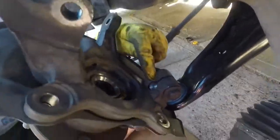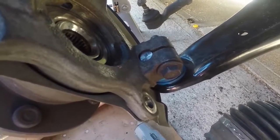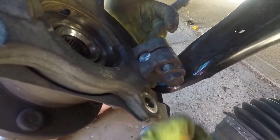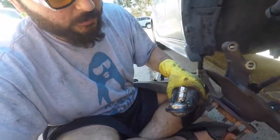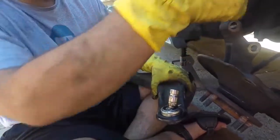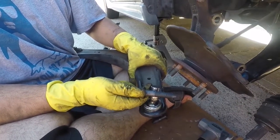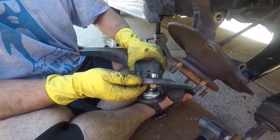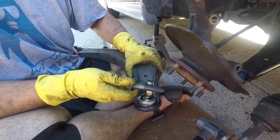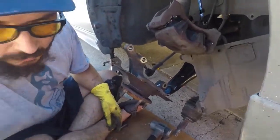You can see the hole on this isn't all the way flush. I looked inside the hole — here we have this arm on the outside, and the bolt goes like this, so it needs that little gap. This is a bigger bolt, and the other one fits better. It needs that gap to go in, and this kind of acts like a lock as well. Since this notch was too high, I brought it down, looked inside the hole, and the notch was aligned with the rest of it. So I feel pretty confident. When it's too high it won't go in, but it's good now — goes in like nothing.